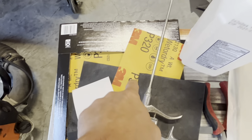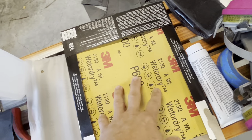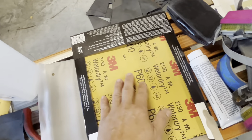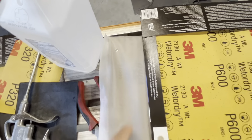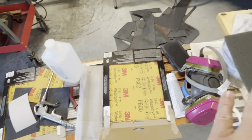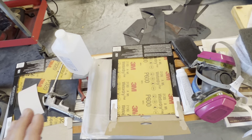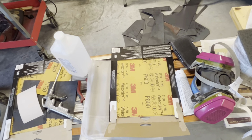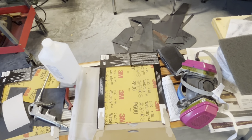This is 320 — this is what I use for the primer. I'm gonna use the 600 to start with to get rid of all the high surfaces, and then I have a 1000 here that I can use for finishing up. So by the time I'm done with all the steps, the base coat should be completely smooth with no high or low areas, and at that point I can go ahead and shoot the clear coat.